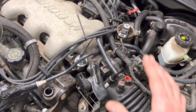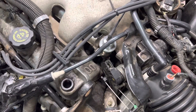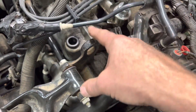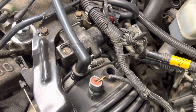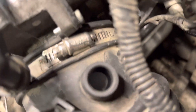So with that smoke going in there, if we had a leak we really should be seeing some smoke coming out somewhere, because we have quite a bit of smoke in there with a little bit of pressure. Now if I pull this cap out of here — this is the PCV vacuum hose pulling right into the intake — if I pull this out I should get smoke.